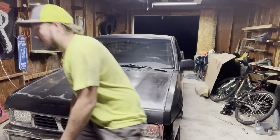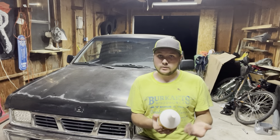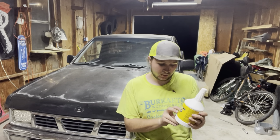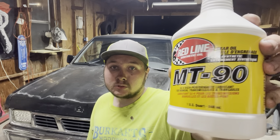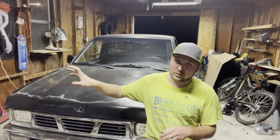To take the transmission out: it needs to be jacked up as high as you can get it, give yourself space. Drain the fluid out of the transmission — you need to be using Redline MT90, which is pretty much the only thing recommended, because it is a GL4 high-performance fluid. They sell it on Amazon, it's not cheap. If you're not changing the fluid, collect it in a clean container and inspect it. Then drive shaft off and out of the way — it doesn't have to come all the way out, just out of the tail shaft of the transmission.